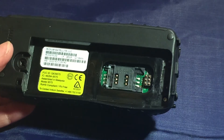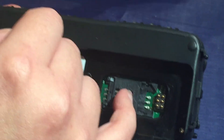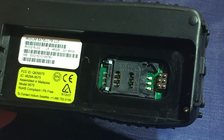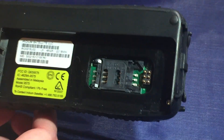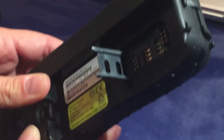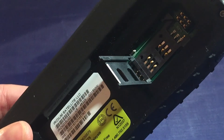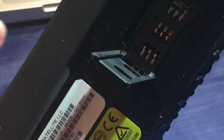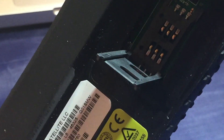When you get your phone and install your SIM card, you'll see it already shows on the phone how to unlock it — it says 'open' with an arrow. So you go ahead and push it in that direction, and instead of trying to lift it up, what I usually do is just tilt it over upside down and you see it already opens up by itself. If you look closely, there is a groove right there on the SIM card latch door, and in between that groove is where you're going to install your SIM card.